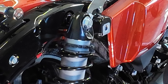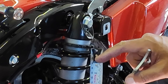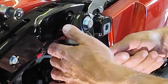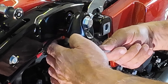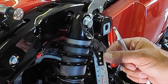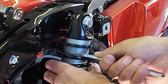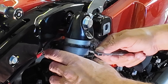That dimension is from the bottom of the locking ring to the top of the preload ring. I probably have about a quarter of an inch to go, which would be roughly six more millimeters. They really tell you to crank this up. If you have a tour pack, 15 millimeters — I can't believe that's the preload for a tour pack, which I have one ordered. So I'm at 12 millimeters. It's easier to take the load off the shock when you do this — I learned that with side-by-sides. You need to jack it to do it. I'm going to go to 17 millimeters.